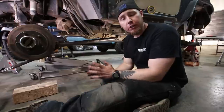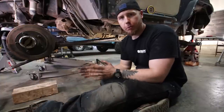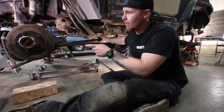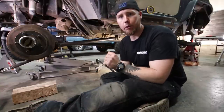The front and rear axles are both at ride height right now. I measured from the floor to the center of the hub: 19 inches, which accounts for the fact that I like to roll around at about 6 PSI whenever I'm wheeling, so I'll lose a little bit of clearance. I use a left-hand thread joint on one side and a right-hand thread joint on the other — this is very common. I can twist the link and give myself a really nice alignment, so you can see that front axle moving. It makes it really easy to fine-tune and adjust your suspension and place your axles exactly where you want them.